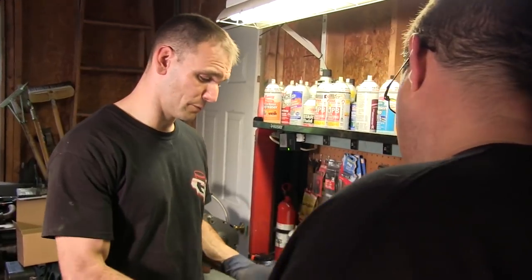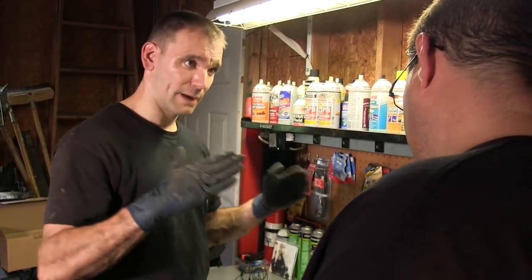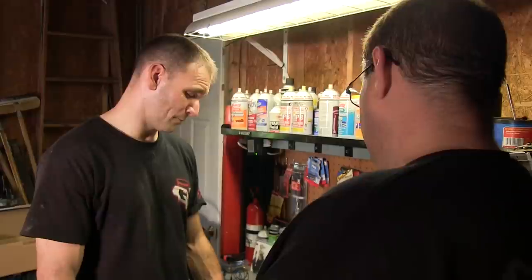Right. This tool would work really well on like my Yugo. It'd be great because you put an adjusting bolt in there, you turn it till you get the right camber you want, and you're done. I mean, there's no caster adjustment. But on this truck, it's going to be a very difficult setup. We can give it a shot.